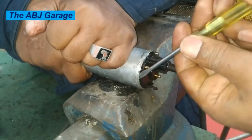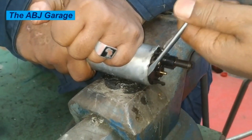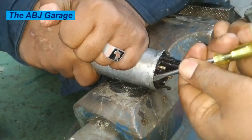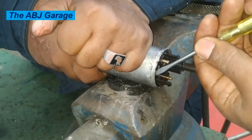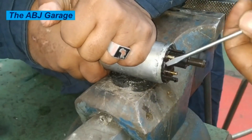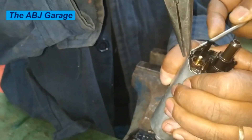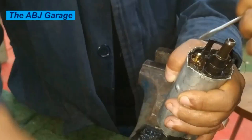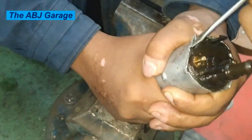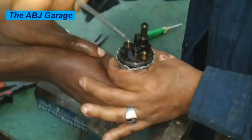Take the carbon brush side up, so we are going to remove the electrical connection side. On this side will be the carbon brush and the commutator of the armature. This is a permanent magnet type electrical motor. By prying the cylinder out and allowing this hardened plastic to get out, we can get access to the electric motor.